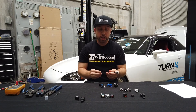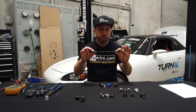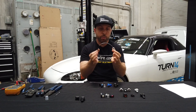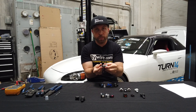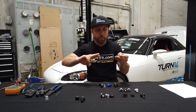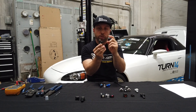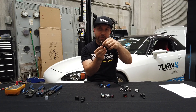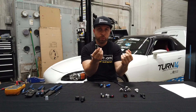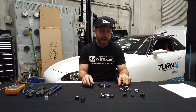There are also injector adapters for the connectors. These adapters are typically found with a pigtail — wire in between — or some are built together as a common pin that goes straight across, making the fuel injector look just extended further up. So if you see your plug way up, maybe an inch or so, it may have an adapter that you can remove and plug your wiring harness directly onto the injector, alleviating the need for the adapter.